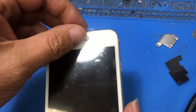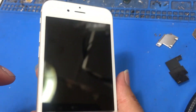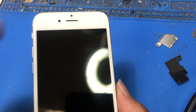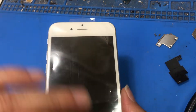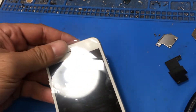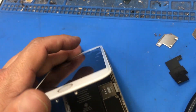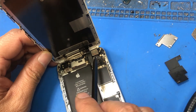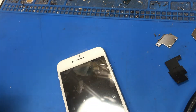If you look at the screen really closely, you can see the phone is actually on but there's no backlight. This is a very common issue, especially when you replace the screen without having the phone powered off. A lot of times you will blow the fuse, but this time it's not that.